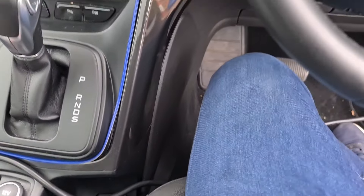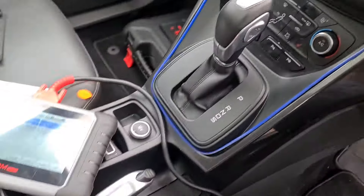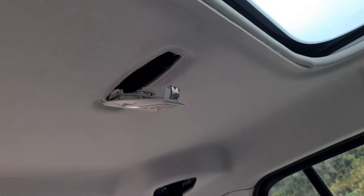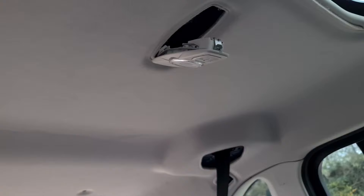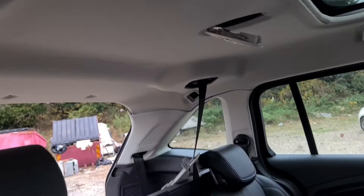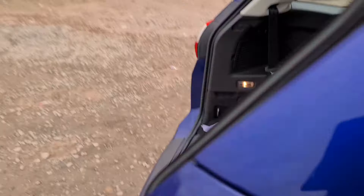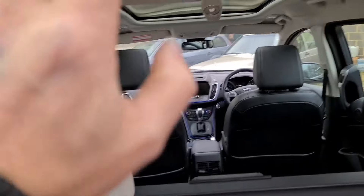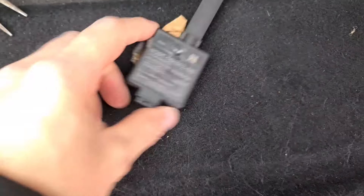So what is the external receiver? Well, on a Ford C-Max I've had to strip some of the car back. Inside the rear door, I've gone up there and found the receiver to be just behind the light there. Inside the back, I've dropped this button down — you can take it right the way out, but it's right here. There it is, it's out.